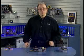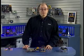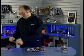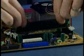At this point the processor is installed and now we need to install the memory before the motherboard is ready to be inserted into the case. This motherboard, like many today, uses double data rate SDRAM, which comes in what we call a DDR DIMM. A DDR DIMM has a single notch offset — not directly in the center — as part of the keying to prevent installing it backwards. On this motherboard I have three DIMM sockets, usually numbered, and I want to install in the first one, typically the one closest to the processor.